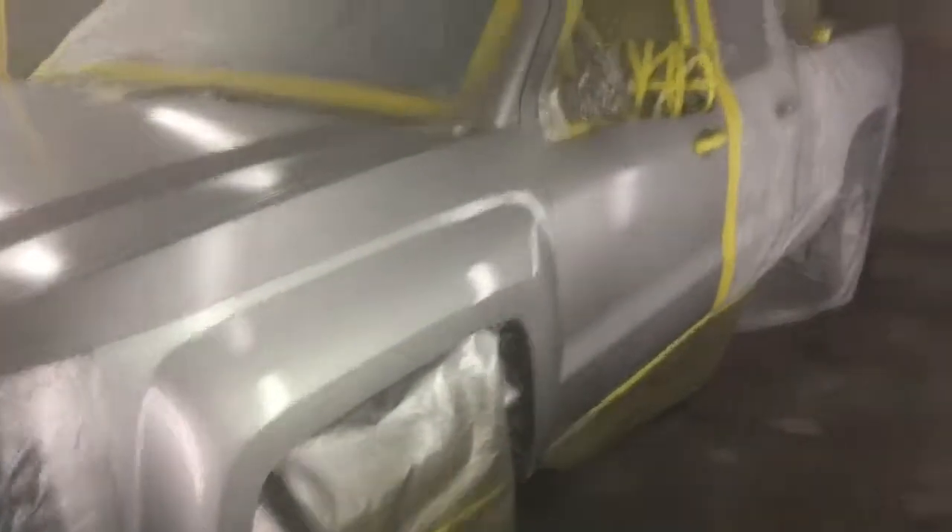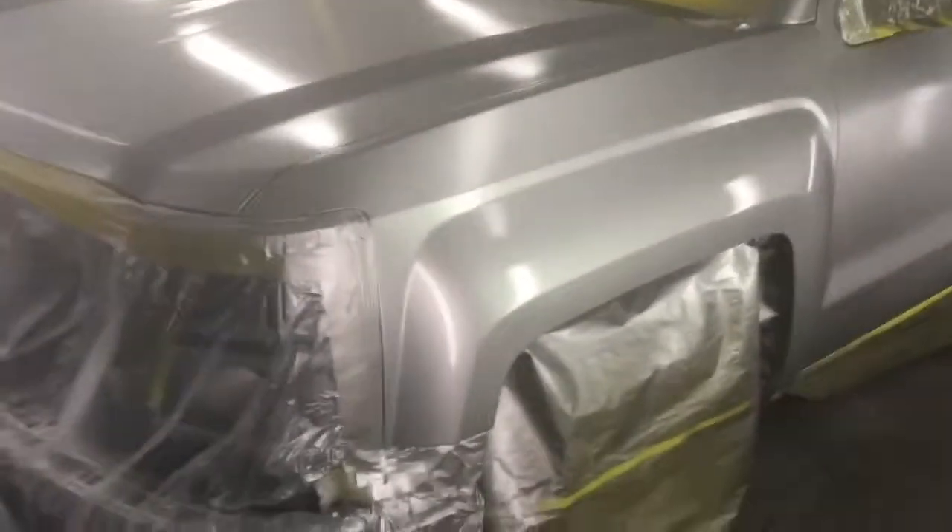Me and Waylon, we're going to bring in the truck and start changing the bed on the Dodge. There's a second coat of base coat silver going on — this thing looks like it's going to be wonderful. It appears to be blending nice in through here. With that dry, I'm going to tack it off and put one more coat. The blend is really pleasing.